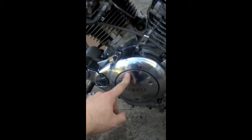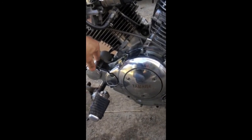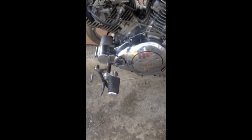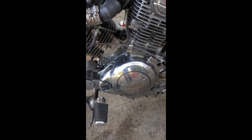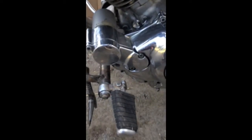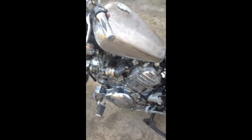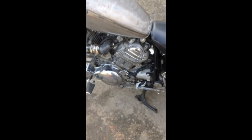If I do paint this, I'm going to make a video on how to remove the left cover on an '86 XV750, because all the videos I found online were for people fixing the starter issue on the '81 to '84, which has a different starter and a different process for removing the cover. I think I'll help out the next guy — show them the hidden hex bolt in there and the bolt on the underside that you have to remove to get the wishbone spring out, so you can pull it off without disassembling your starter like I did. But for now, that's that. We'll see you soon.